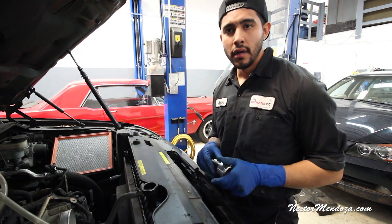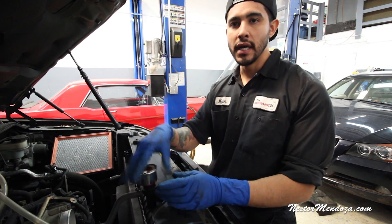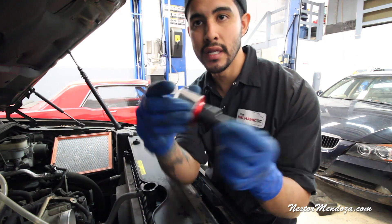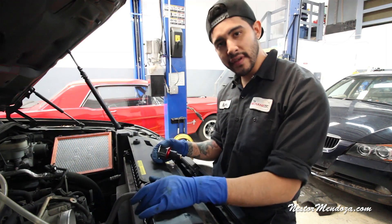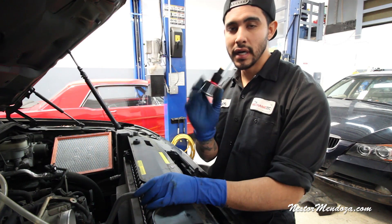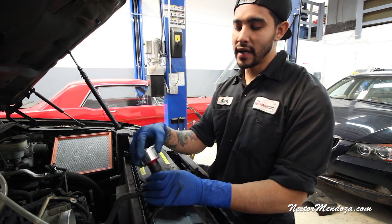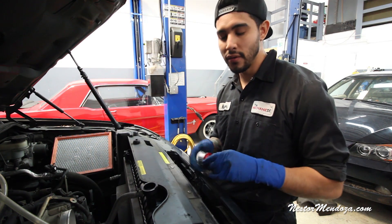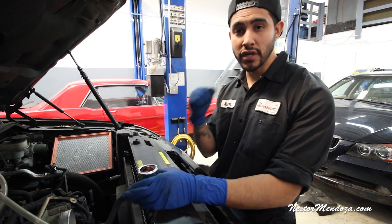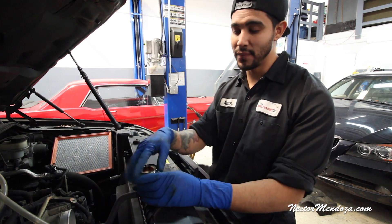Let's go. So it's pretty self-explanatory. You put in the adapter, then you're tying down the top piece, and then the top piece will pinch this copper part up against this rubber part and seal up the system. I do have the correct adapter for this radiator, but I want to show that you can use this universal adapter with the vacuum filler. No problem. I don't think we're going to have an issue.